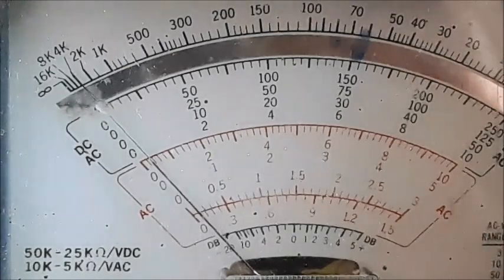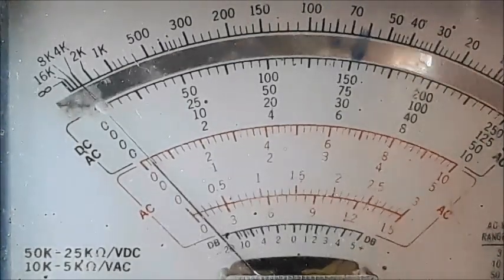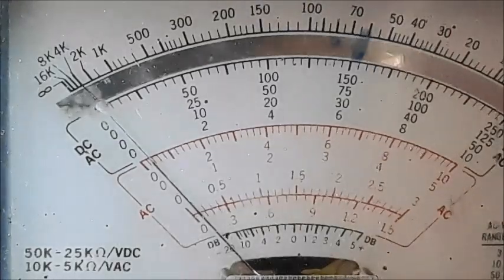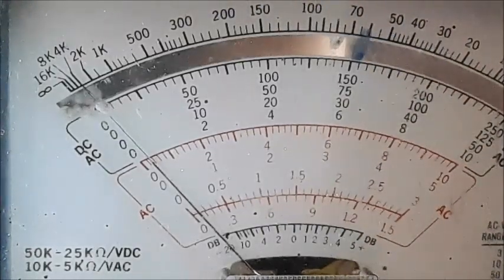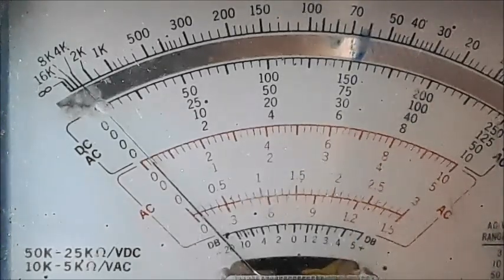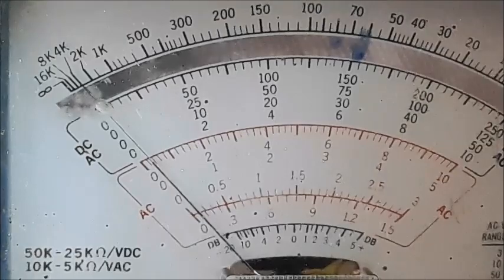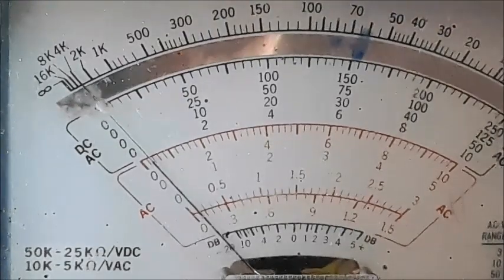It will be because it's not connected to any coil. Can you tell me anything about this on a coil — is that correct or not? I still have a suspicion that the wire going from the points inside the distributor out to the positive of the coil might be shorted in that little path coming out of the distributor. There might be a problem there as well. Let me know in the comment section for those with electronics knowledge, and I will hear from you and we take it from there. See you in the next one, bye-bye.